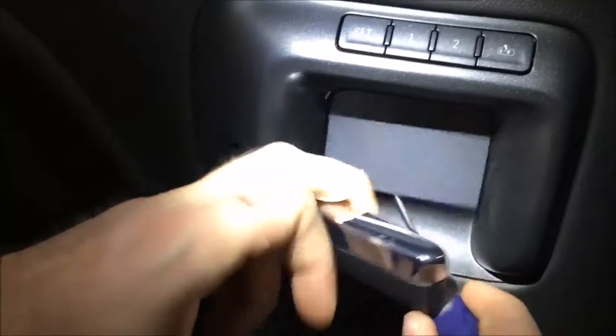Alright guys, so we're going to start with the door panels. They got to come off so we can get this guy, the little trim piece which houses the mirror, off. So the door panels, we've got some little hidden panels there, 7mm behind that. It's got to come out. One down there. Pop that guy up. Got a couple there we got to work with. And then down at the bottom of the door, we got a couple 7s we're gonna work with too. Then this should just pop right off, so.